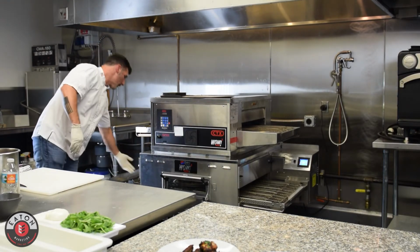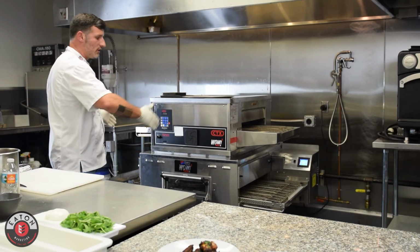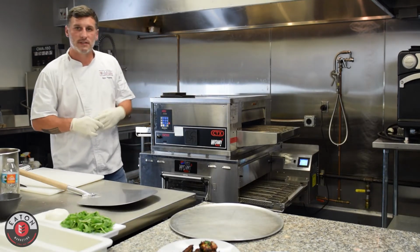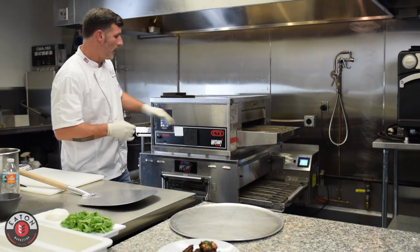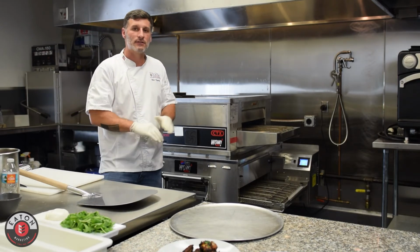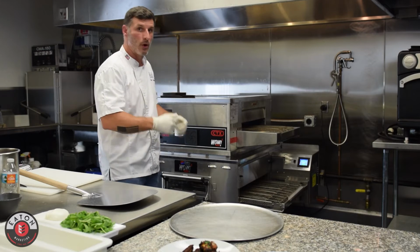If you look on the sides, very similar again to a TurboChef, I use that as an example, you do have an open-ended cavity, but it's almost like a heat shield on the side to where you're containing that box, you're containing all that heat and energy. One of your parts and labor warranty does come with a startup from the manufacturer's representative. It can come in a 3-tiered configuration. It has an energy saving mode on it. If you're not using the oven, like during the middle between the lunch and the dinner service, it's going to drop the temperature down about 40%, so you're going to contain a little bit of that money instead of it going out right in there.